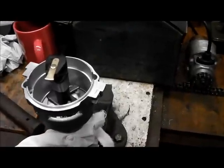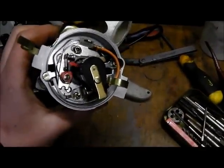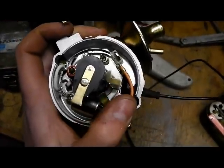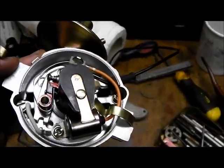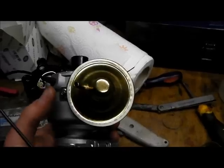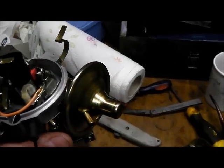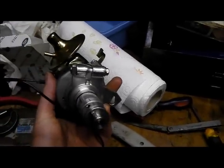In the next video I'll get it put together and hopefully get it fitted up. Well here we are - we have the finished project. All that remains now is to fit it and see if it actually works. It all looks very promising. I've checked the points gap at each hump on the cam and it's the same - there's no play in the spindle so that part should be really good. The only thing I have any concern about is the vacuum advance mechanism - I expect that may be too strong, so it may be that I have to put the advance unit from the old distributor on it. But we'll stick it on there and see what it goes like.